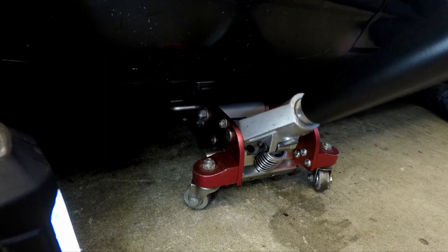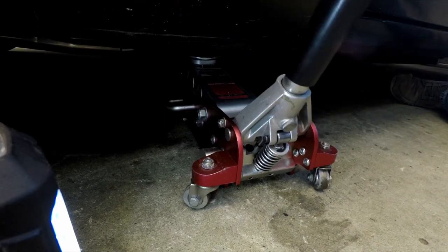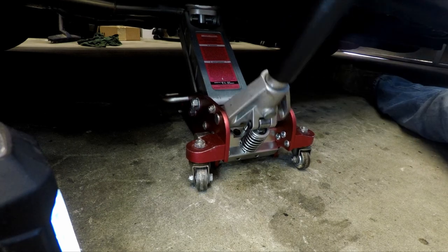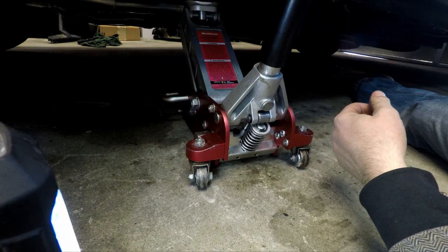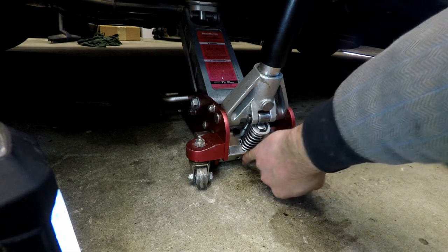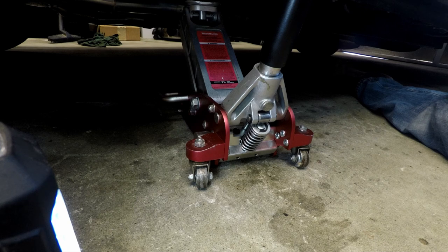Back under the car now. We'll load it up and lift the car to see if we get any leakage down by that piston. Still looks dry. Wheels are off the ground, nearing the midpoint of the stroke. I'm just going to leave it like that and see what happens. So far I don't see any leakage, and if you remember, you could see it start to form around the base of the spring getting wet and then weeping down the body of that aluminum ram — but I don't see any leakage right now. So far it's a success.